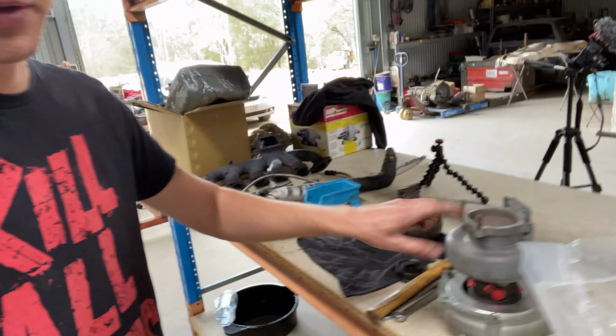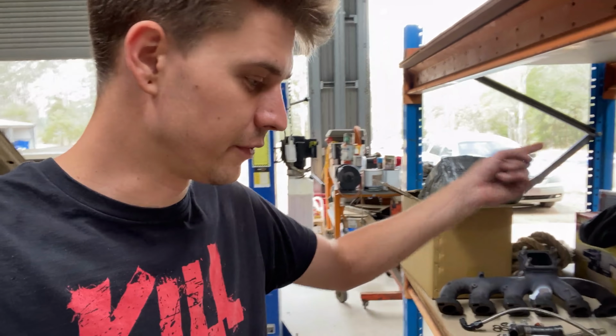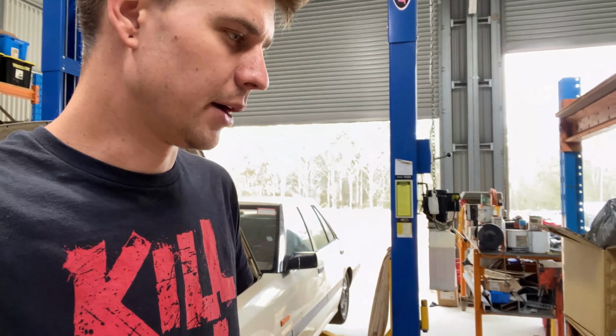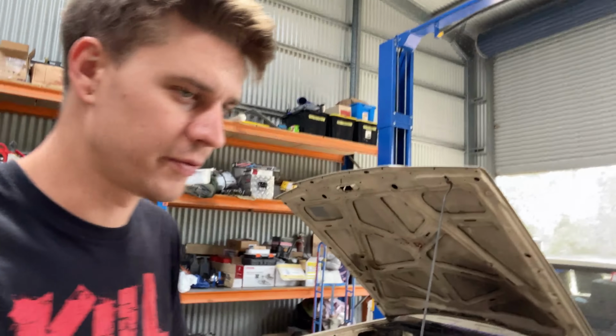I looked at the Garrett compressor maps for the 3076 with a 0.8 housing and the 3582 with a 0.6, and the compressor maps are almost identical. They're very similar, so it shouldn't be too big of a problem. I just have to make sure it's actually physically going to fit, because I did have to make some room even to fit the 3076. So it's a matter of chucking on the manifold, making sure it clears, and dummying it onto the car to make sure it fits.